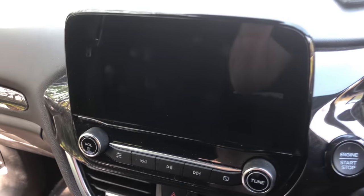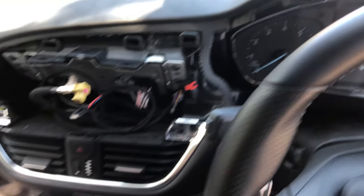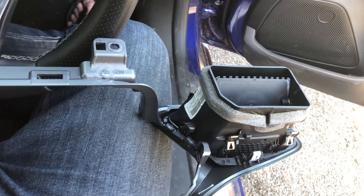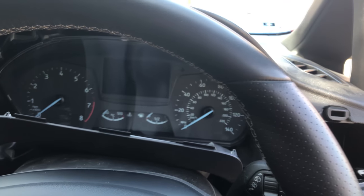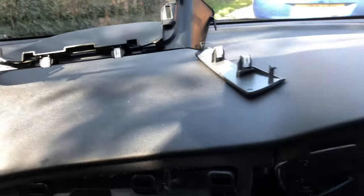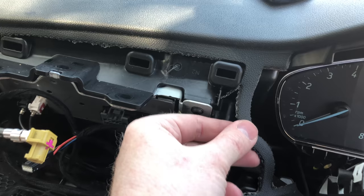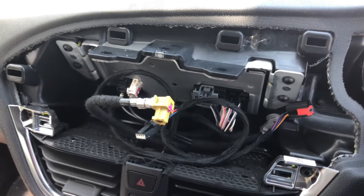After a long fight I finally managed to remove the plastic housing. Note that the air vent on the driver's side does also come out — it's a bit scary and I may have dropped a clip in there, but it looks okay. Interestingly, even though it's all behind the panelling, they left a structural piece in there. Removing the SYNC screen was quite easy — just whip out those three bolts.